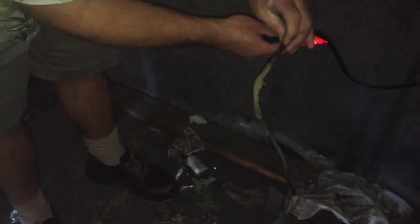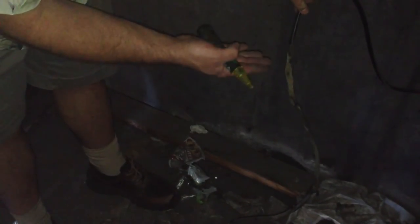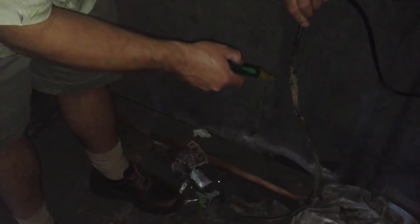As I run along my cord with my tester, I see no power, no power — wait, suddenly I have power. We notice here this cord's been damaged by people rocking the machine. I'm careful not to get electrocuted by touching that because there are damaged wires there. So this would be a simple process of just changing out the power cord.